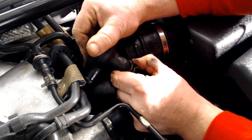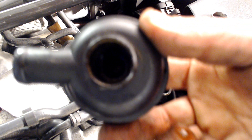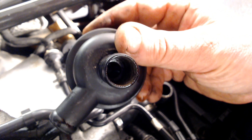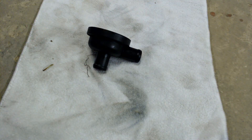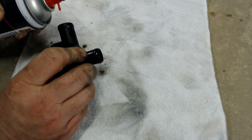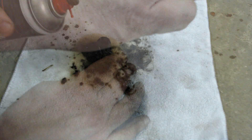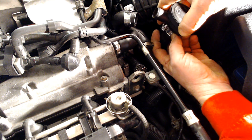With the clip removed, the pipe felt like it had welded itself onto the puck so I gently prized it away at the end of the pipe to loosen it enough to pull it off. That is the puck detached from the pipe work and on first visual inspection it does not look too bad. I was expecting the connectors to be half full of old oil restricting the airflow, but there is no sludge to speak of and very little oil residue. I was given a tip by Jules Matthews to clean the puck out with petrol which will act as a degreaser — thanks for that top tip Jules. I am also going to clean mine through with some spray degreaser so I can see the aerosol venting through the other connector as I spray it. Using a white microfibre cloth I can see anything that comes out of the puck when I pour it out. I did this a few times until the aerosol residue that came out was fairly pale in colour, then let the degreaser evaporate fully and dry out.